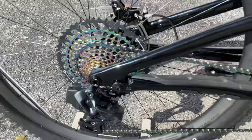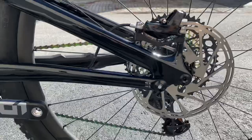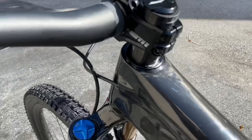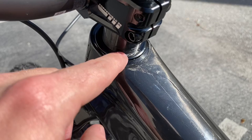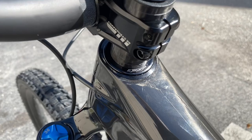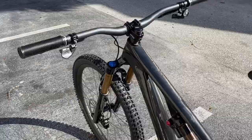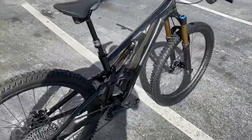This only changes the bottom bracket height — unlike before where it would also change the head tube angle. Now you can do those individually. There is another flip chip on the other side as well, so you have to change both when going high or low. Up here you can actually change the head tube angle by two degrees. There's a race for the bearing, and behind it there's a little metal piece. You loosen the stem, take it off, remove the spacers, and flip this around to get two degrees more slack or two degrees more upright depending on your riding preference.